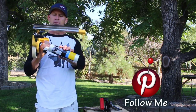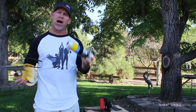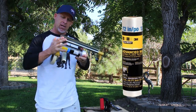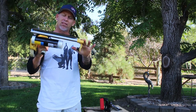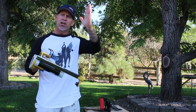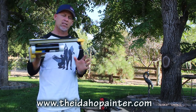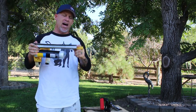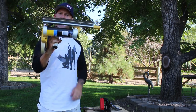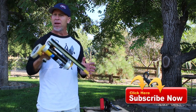Now I can set it up with my masking film — I'll hook it up here and show you how it works. I'm going to take my masking film right here — this is some 3M 72-inch masking film — and load this onto my handmasker. With the old style, without this attachment, the masking film would flex on the masker and tend to make curved lines when you tear your plastic. Now with this new attachment, this little thing slides right down this little rail and goes into the other end of the plastic, holding it stiff and sturdy. That's what makes cutting a straight line and tearing your plastic a lot easier.